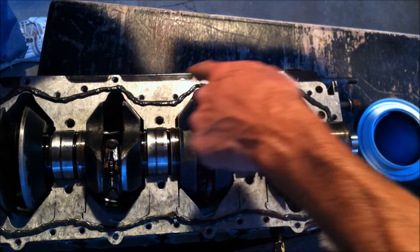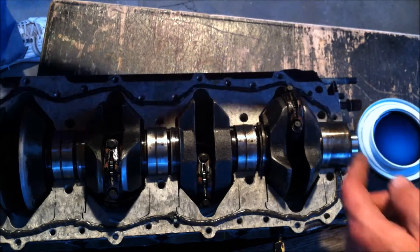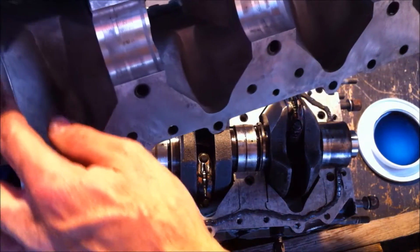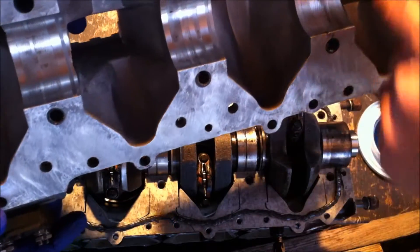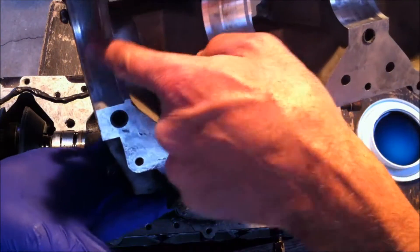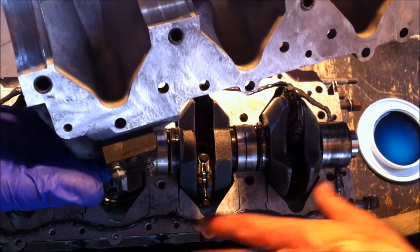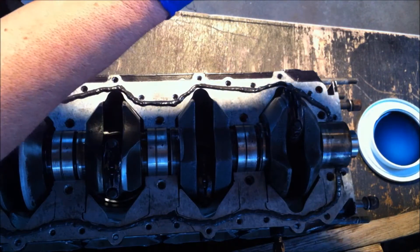You can see we've run this bead along each side on top of that seal. Now I'll bring this to the upper part and I'm going to clean this all with a solvent — each portion here that goes around the bearings and then at the top in the bore here — then I'm going to put Loctite and we're going to lower this down onto the main crankshaft assembly.